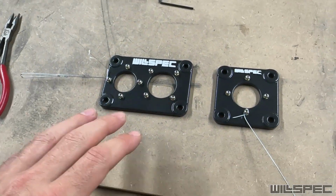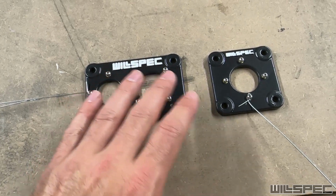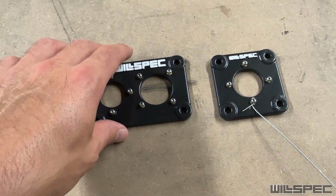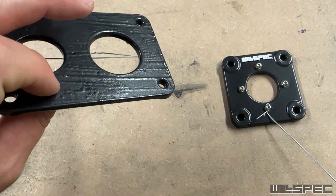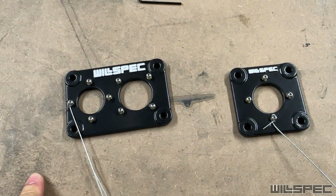So what we're gonna do now is we're gonna get these wires up here. We're gonna take these bolts out, double check that the connectors fit. If they won't, we'll sand out these holes just a little bit, and then we'll lay some sandpaper on this surface and run the back across it to smooth the back out. Time lapse.